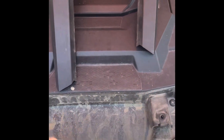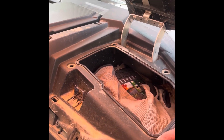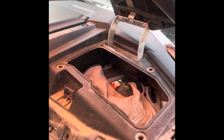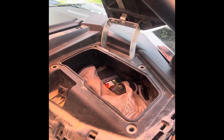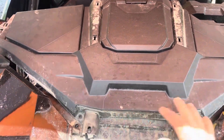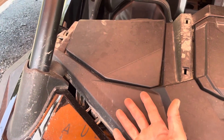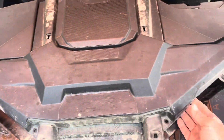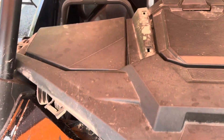After we remove a total of eleven T40s, we go ahead and take the four T25s out as well, so that it comes out a little bit easier without the glove box attached. Once we've got the eleven T40s out and took the four T25s out from underneath the glove box to separate the bottom tray, the rest of this now pops up and straight out on the dash piece.